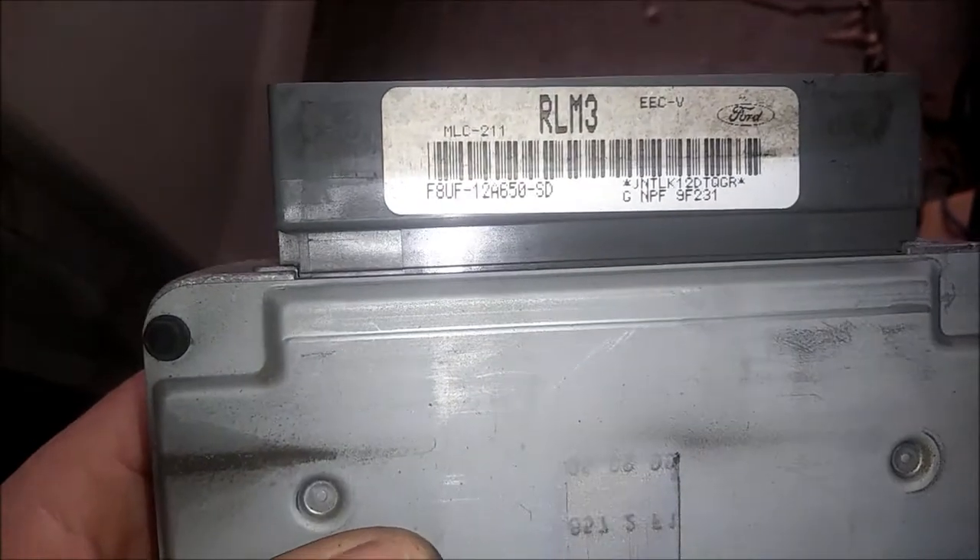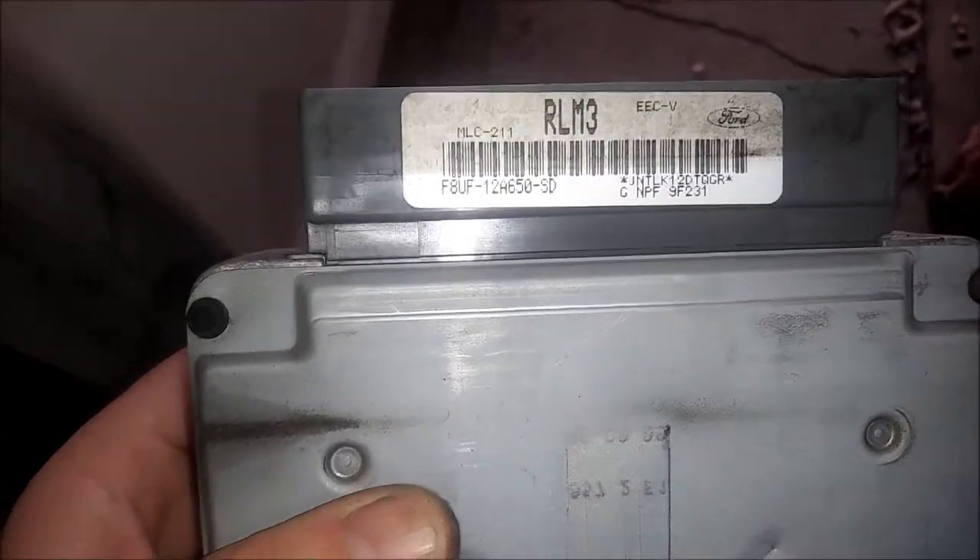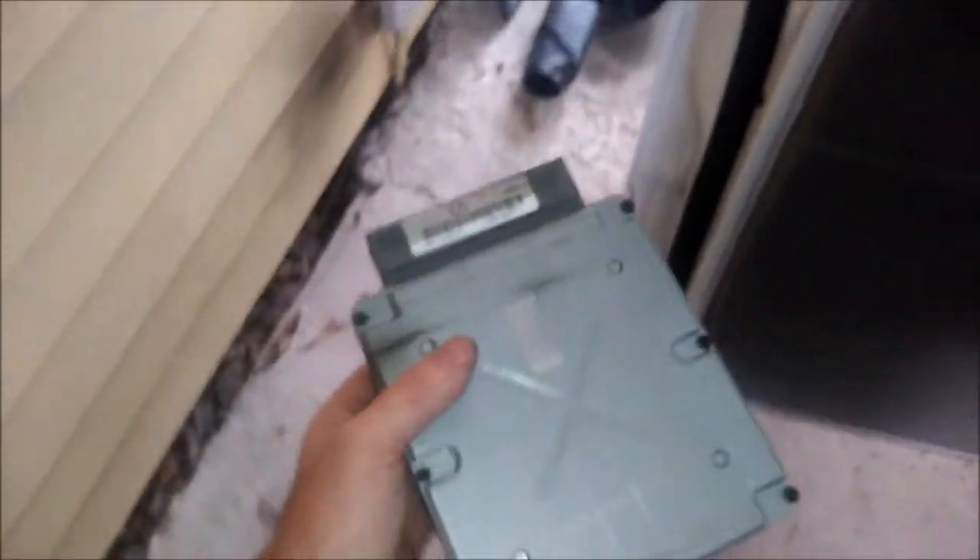We happen to have the 4R100, and we got axle code 32, which is a one-ton Dana 60, rated for one ton, over 6,000 pounds, with disc brakes. We got 4.10 gear ratio. Now, this was our computer that we pulled out — it was for a bi-fuel vehicle. We've already tested another computer in here that was for a 4R70W transmission, and it would shift first and second. After that, the transmission was starving for codes — it couldn't get a shift point reference. So that wasn't going to work.